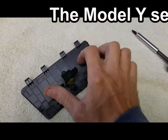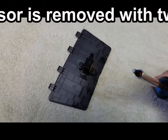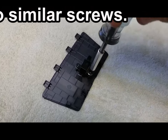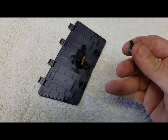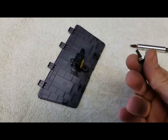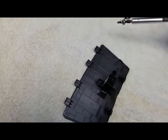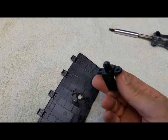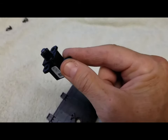Here at the workbench, we've got the lower cover and a number 20 Torx star head bit. Remove these two screws — Tesla puts a couple of washers under each screw, likely because the screw length was a little too long. That's the way mine came from the factory; yours may be different. With those screws removed, the sensor merely pulls right off, and it will be installed in the new soft shroud.